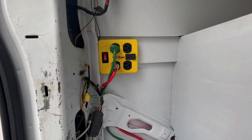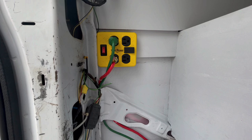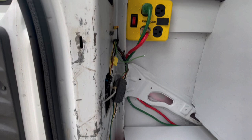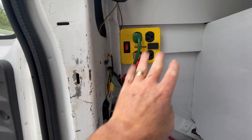Today I want to tackle the shoreline — the AC power that will come in from outside. This will give me the ability to plug in at any 15-amp receptacle and be able to charge my batteries or run any 110 AC appliances from inside the van. I've got this distribution box set up here — it's called a Yellow Jacket. It has a 15-amp circuit breaker, two USBs, and four receptacles.